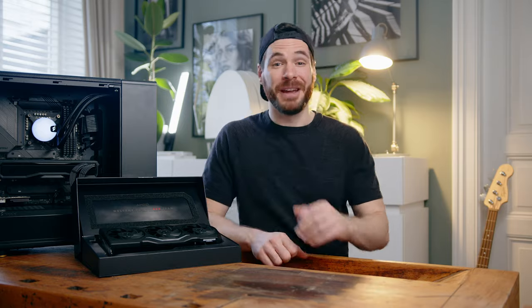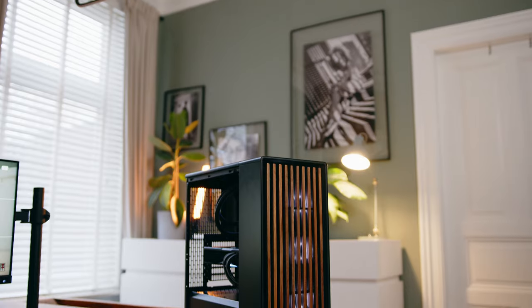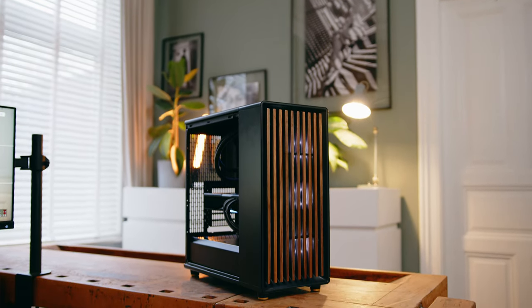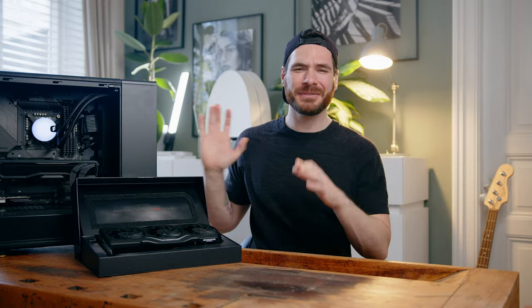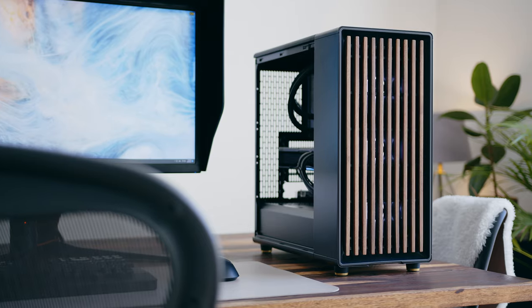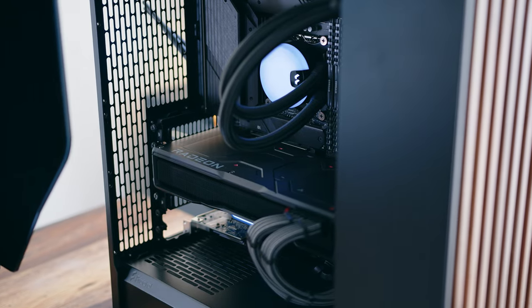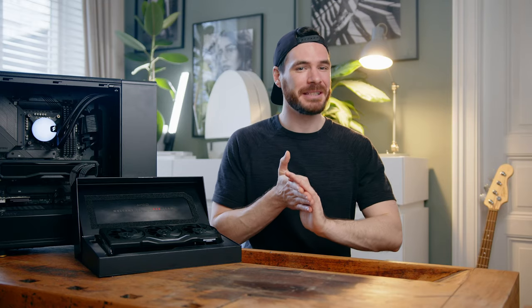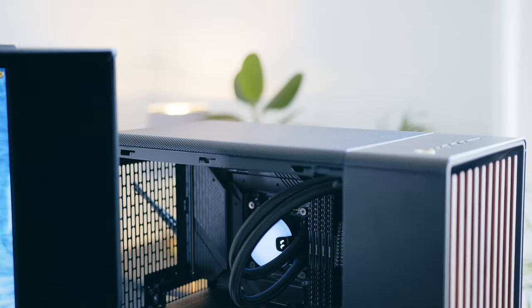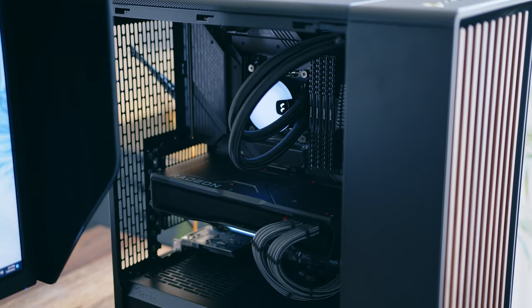Apart from that, I am a big fan of this case. The compact size and super clean look are a breath of fresh air for a PC case, and the all-blacked-out look from my hardware goes very well together with AMD's new cards. That being said, you should be aware that you will have a hard time fitting one of Nvidia's new RTX 4000 cards into this case should you also use a 360mm AIO in the front like I did, so please be sure to check compatibility with your desired hardware. Speaking of the new cards, let's finally talk about what Team Red has to offer for 2023.